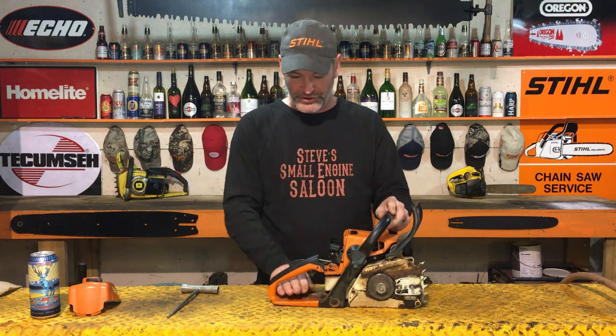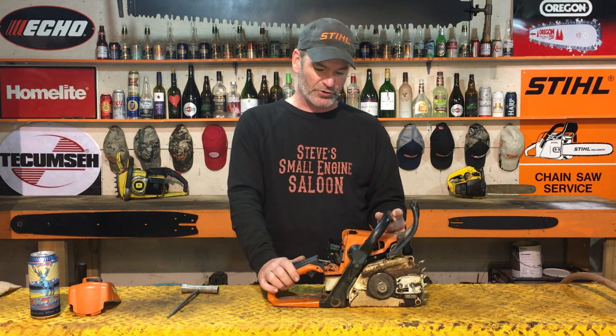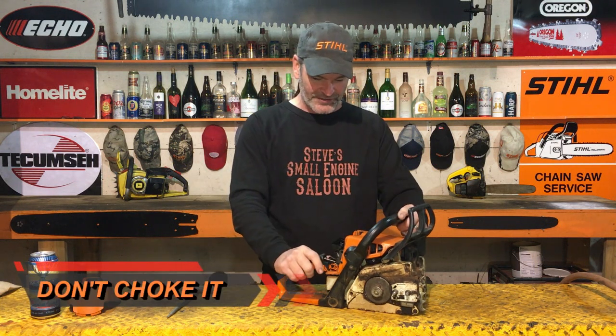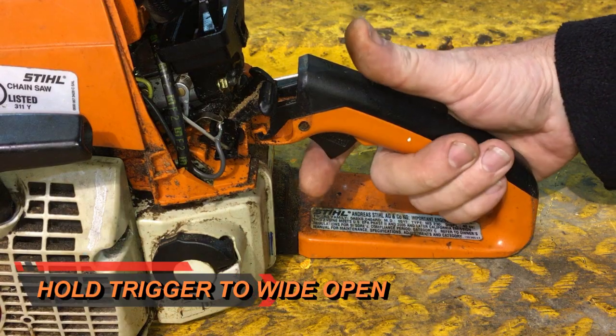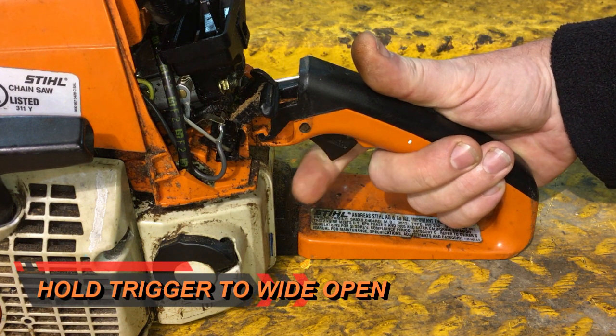Because I know the owner's manuals and stuff out there say put it on the ground, either put your foot through here to hold it down, put your knee on it, however they're telling you to do it. That's not what this video is about either. I'm not getting into that. Start it like you normally do, with two exceptions. Don't put your choke on. Make sure it's just in only the run position, because you don't need to choke it anymore. It's already got enough fuel in there to run. And the other thing is, hold that trigger wide open. Get a lot more air flowing through there to blow that out as good as it can.